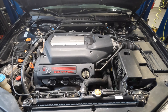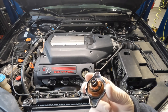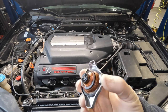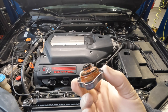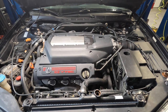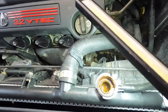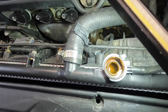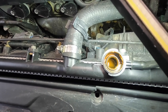To confirm my theory, I went ahead and removed my radiator cap. Much to my surprise, what I see here looks like — to say the least — crap. That is rust inside of the radiator cap. It doesn't really get any better from here. When I shine a light down in there and zoom in, you'll notice there is a lot of discoloration, a lot of muck, and the coolant is kind of orange.